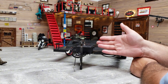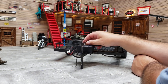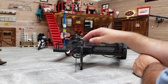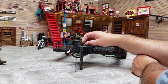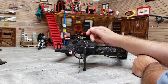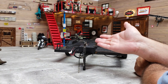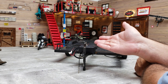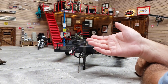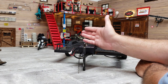On to the biggest problem that they really need to do something with — because this is going to cause major problems for somebody. This switch that's on here — it's just a two-position switch. The guy I was talking to on YouTube had a three-position switch with a flashing four-way flash feature. This one did not come with that. It was wired completely wrong — sending feedback. The batteries were becoming napalm when you turned them off. It did turn the power off to the lights, but then it sent a direct short right back to the battery pack. It ruined the battery pack and melted it. I had to rewire everything. I properly wired the switch to actually break the circuit when you turn it off.